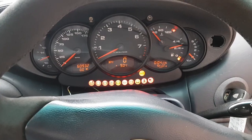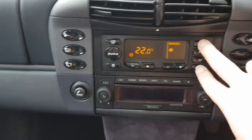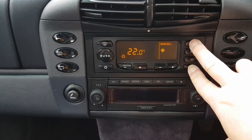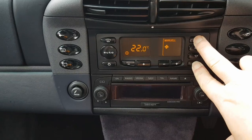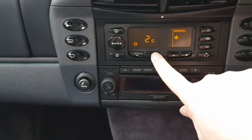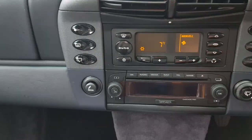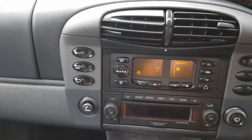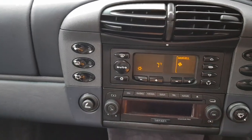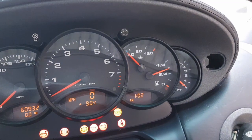Battery's now reconnected, so turn the ignition on. I'm interested in the digital readout of the temperature here, so press these two buttons. As this is a Mark 1 996, I can get a digital readout in here. Press and hold these two buttons for a few seconds to get the indicator coming up, then I can select 6C on here. That shows 7 degrees C. So I've got 7 degrees C showing on there, and 3.5 volts showing on my sensor, and that's way over to the left.